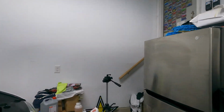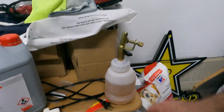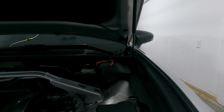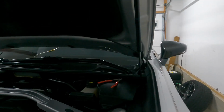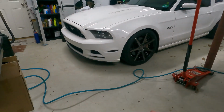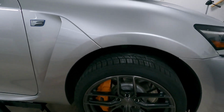Now what you will see here is we did end up having to refill our refiller because we used all of that fluid here. So we're gonna go ahead, reinstall that back onto the master cylinder. And like I said, we're gonna move over here. I'll do 2 bottles worth driver's side, 2 bottles worth, and then we're done.